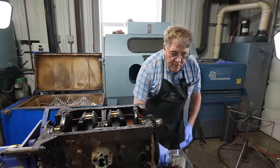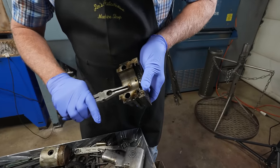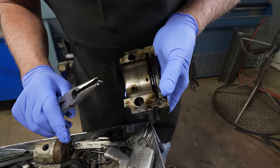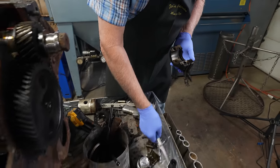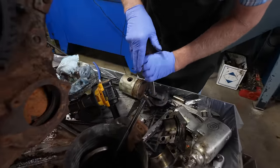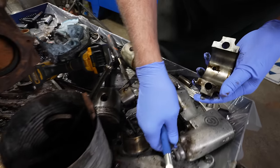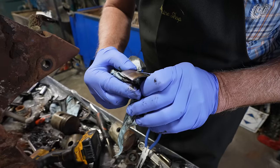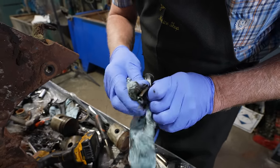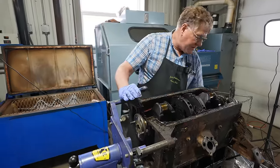So now we got this cap off. There's that pin I was talking about — a little dowel pin. Make sure you save those, they're easily lost and hard to replace. Another one in this cap — let's see if I can get the bearing out of it. There's one more little pin there. Stamped standard, FM Federal Mogul, 10-52. So anyway, remember to put those back in before we put the crank in. Now, here's another interesting point on these cranks — look at the counterweights. They're literally bolted on, and then the bolt is spot-welded on there so it can't come loose.